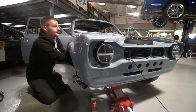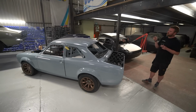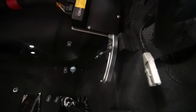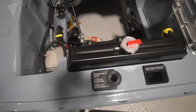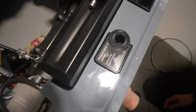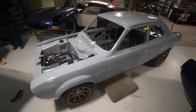James has then machined a little brass collar, if you like, that is how the cable anchors to the handle in the car. So it's held in place to the handle with a little through bolt, and then the cable wraps around the brass collar and crimps back onto itself, so that where it's anchored it's not got any sharp kinks or stress points on it, because it's literally a round piece and then back onto itself. And that works really nicely. It's nice to feel the action of that, because obviously we've designed the latch itself, the spring in there and the handle, so it's sort of nervously wondering how the bonnet release will feel. But yes, it all seems good. I think he's just got a temporary bolt in at the minute while we waited for the shoulder bolt to arrive.